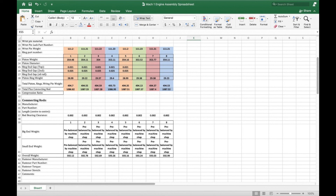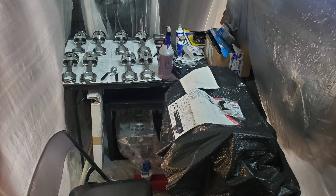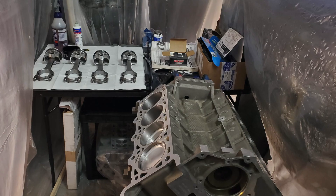That means your rotating assembly could probably spin up to eight or nine thousand RPMs, no problem. Now my heads won't do that because I'm using stock OEM replacement springs, but as far as the rotating assembly goes, it's spot on. I'll have a lot more videos of the build — I'll go over ring end gap, assembling a short block, a whole bunch of goodies coming up. So stay tuned, please like, subscribe, and tick the little bell. Thank you for watching Mike's Garage.